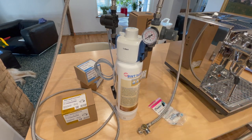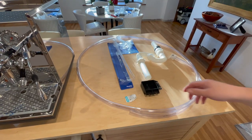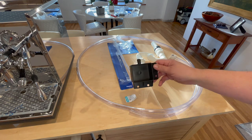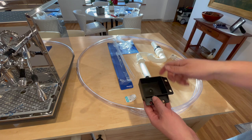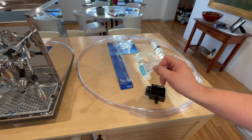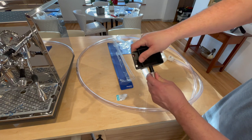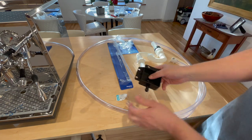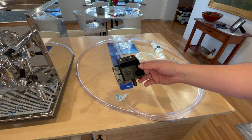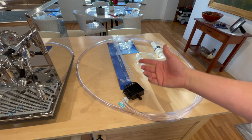The drain was a little harder to figure out because the kit didn't come with anything. The only thing included is a small catch basin that goes underneath the drip tray and catches water when you remove the plug. I went to the store and found that one-half inch inside diameter, three-quarter inch outside diameter clear vinyl tubing fits pretty well - you just push it over the top. I'll use a stainless steel hose clamp to hold it. I like the clear tubing because I can see if it's working or if coffee grounds are getting stuck.